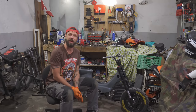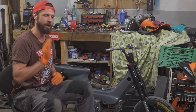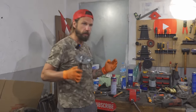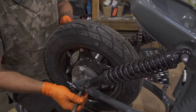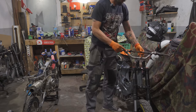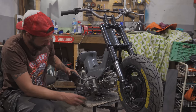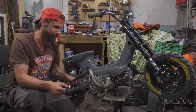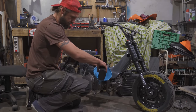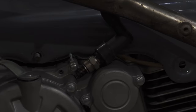As you would know, I'm a big advocate for safety. I'm gonna put the rear brakes on before I start the engine — because otherwise I'll start the engine and go for a ride without brakes, and that would be stupid. This time I need to be better prepared than with the original engine. No brakes might be too dangerous, even for me. The bicycle steering wheel is too fat and the throttle tube doesn't fit, so I'm borrowing the steering wheel from the pit bike. I also installed the oil cooler — thank God for Google, because blocking it off would have caused catastrophic oil starvation to the cylinder head. Just to prevent any runaway throttle situations, I also rigged up a kill switch just in case things go south and brakes don't work.